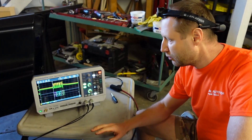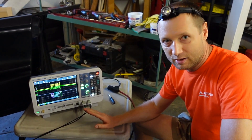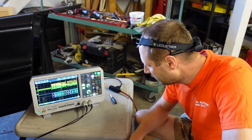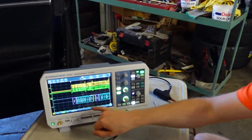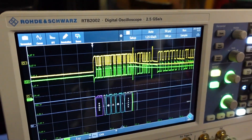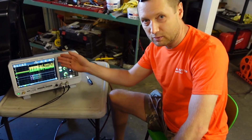We temporarily connected to the chassis CAN bus line, and as you can see, our signal looks pretty good — it can be decoded and everything. Right now we will swap to our target line, the powertrain CAN bus, and we'll see what happens.